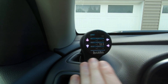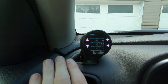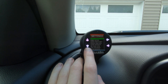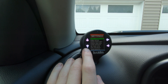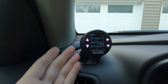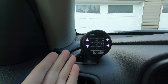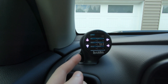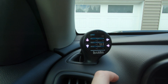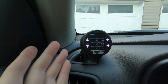First thing, right off the rip: just because this thing says Banks on it and Banks sells mostly diesel performance parts does not mean it's only compatible with diesel vehicles. This will work with any vehicle 2008 or newer. I know it will work with the 6.0 stuff from the mid-2000s as well. As far as the amount of information you're going to be able to view, that's going to depend on the vehicle you're communicating with. Good rule of thumb: the newer the vehicle, the more parameters you're going to have available. Something from 2008 may not have engine oil temperature — it just depends on whether that vehicle already has that sensor built in.